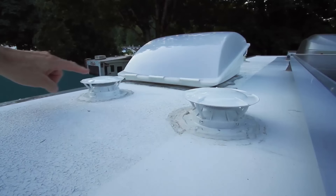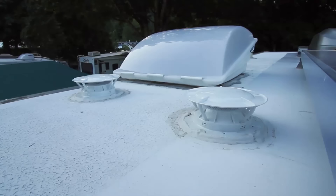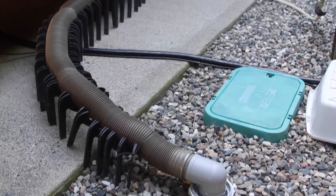There is however an unprotected pipe with a direct connection to the sewer hose: the tank vents on the roof. This can allow air from the sewer system to come up through the roof vents. If you've ever smelled sewer odors in a full hookup campground, it's possible that someone's RV is venting the park sewer system out through their roof.